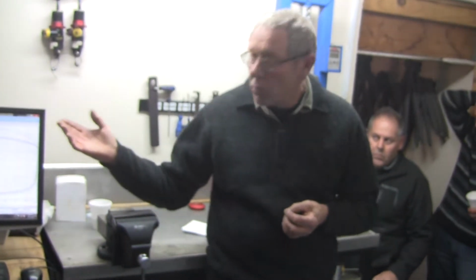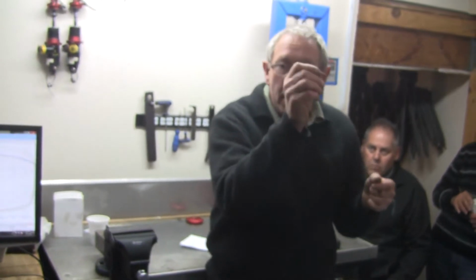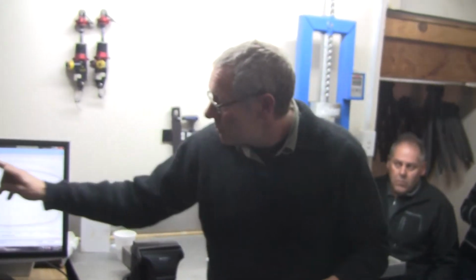And that's a big problem because you might be roaring around going, oh, that little bit of extra rebound really worked good. So you go 1 more click, and it's overdone here, but it's okay there. That's what I'm trying to get to: when you go twiddle, twiddle, twiddle, unless you know it's working properly, you're really shooting yourself in the foot, and you're probably better just to leave it alone. As I said right at the beginning, our brains say we're quite clever, let's have a play, but normally we shoot ourselves in the foot while we're doing it. So that's my take on those adjustments.